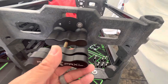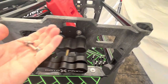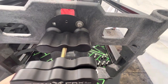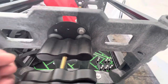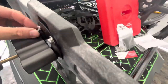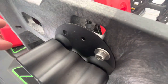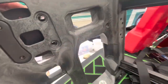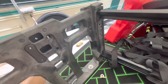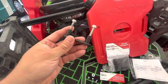I've put one in place just so you can see. I've sourced these M6 316 stainless steel bolts and some 316 stainless washers. You can use whatever style you want. The ones that came with the Rotopax are carriage bolts — those are nice and you could put those through. You can see the molding in the base plate is conducive to a carriage bolt, though the ones that come with the Rotopax are a bit short, so you could just use your standard hardware.